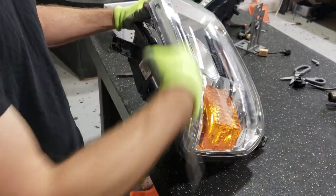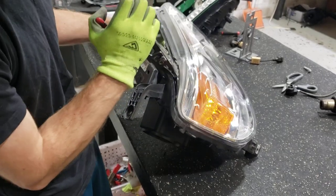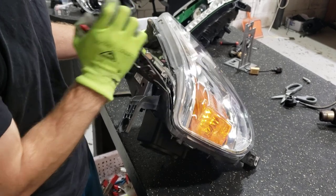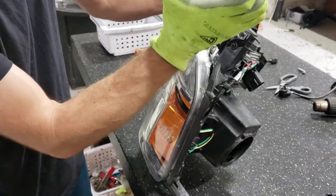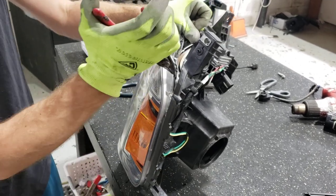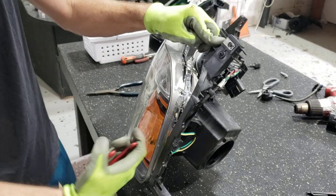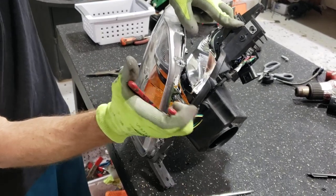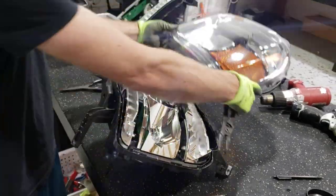Now we've got 75% done here pretty much. But the problem is this corner is a little tough with the boards and everything in here — you can hear it kind of binds up. So give it a little bit of pressure. You have to know when to stop because it's going to start rubbing on things. You want to push out this way — push the lens out moving forward, not pull. Be gentle, work your way around, wear gloves, and you're going to peel this out of here. It's going to make some crazy sounds but that's just plastic releasing. Work your way back and it's pretty much out. Gently remove it.